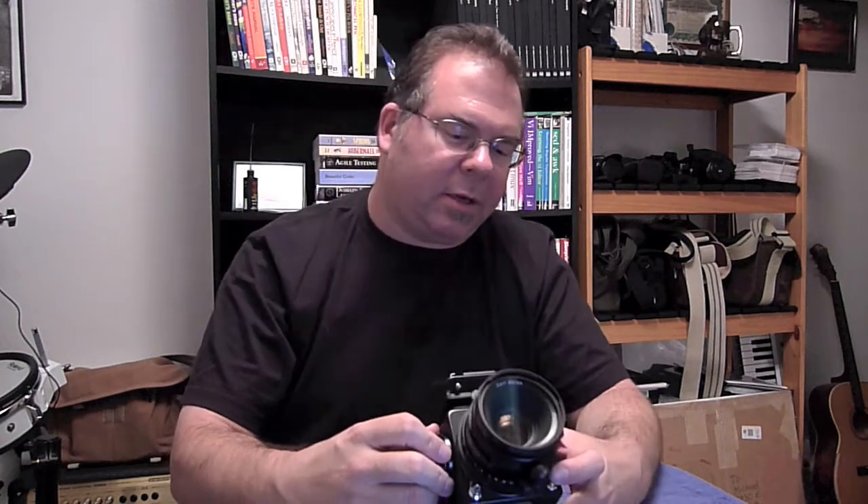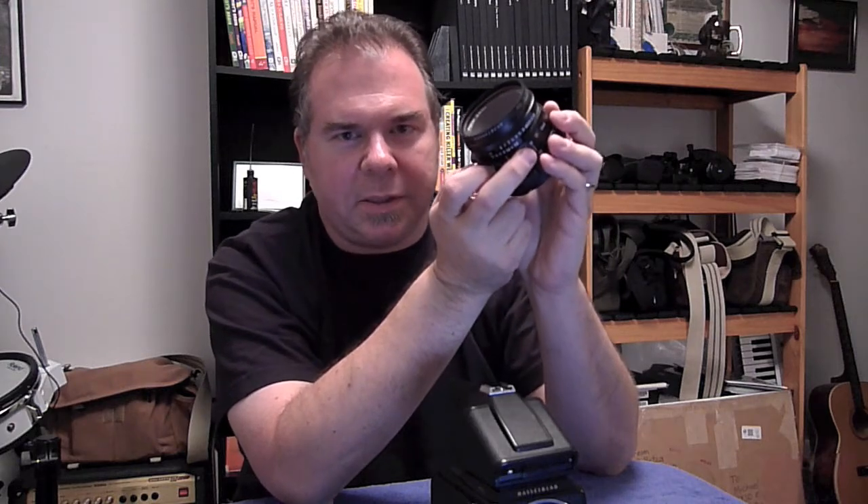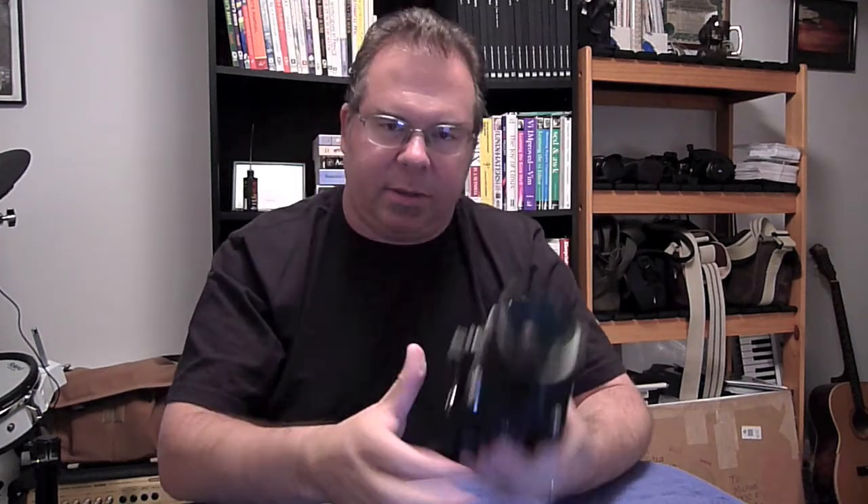One final thing I kind of left out before is checking the lens itself. I'm going to take it off the camera and hold it up to a light source to see if there's anything growing around the edges or any cloudiness or haziness. If you see that, it's a bad sign — you can have the lens cleaned but it's not inexpensive, so it's probably better to look for another one. Dust is really not that big a deal. It's mostly haze and fungus you want to worry about. This one looks good.